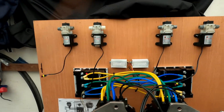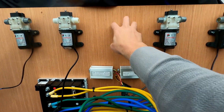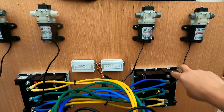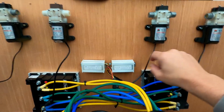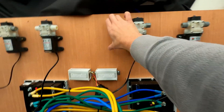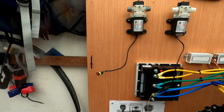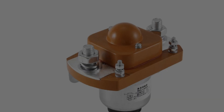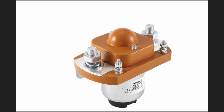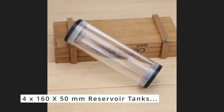The water pumps are now up, and I've left some space in the middle here for a three-way 48 volt bridge — I'll have two positive and negative inputs coming in that then go out to separate electricity for each of the motor controllers. I've also left space for the water reservoirs and the water cooler fans on the sides. To move the project forward I've ordered two DC contactors at 48 volts and 400 amps, as well as four water reservoirs — one each for the motor controllers and one each for the actual motors.